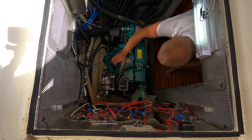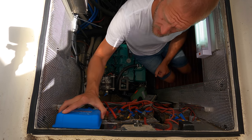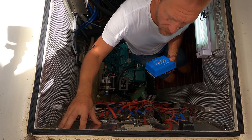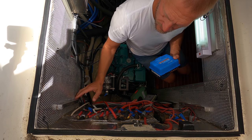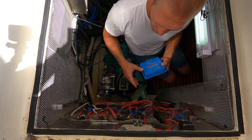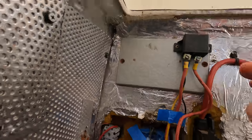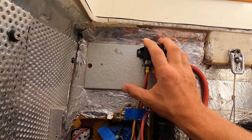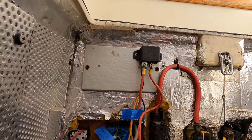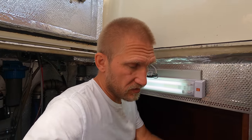This is the place where I think could be a good position for the DC-to-DC converters — one on this side and another one over here. There's a wall coming up here so you get some protection from the heat, and I think it would be okay. There is a Bosch relay on this side, but I can remove that because I don't need it anymore. That relay was to combine the starter battery with the 12-volt bank during charging, but since the starter battery will now be the only battery connected to the alternator, I'll just remove it.